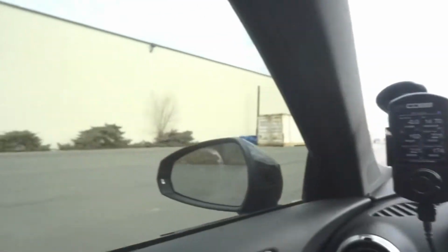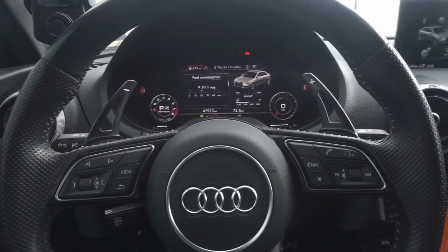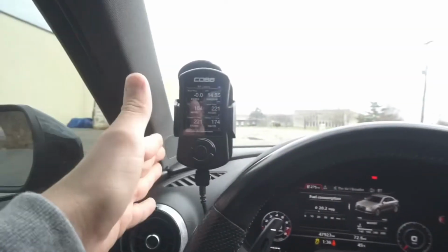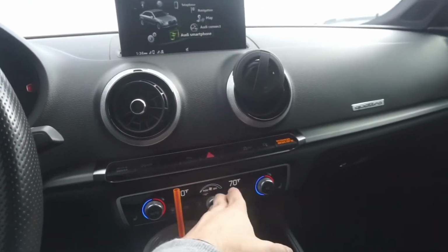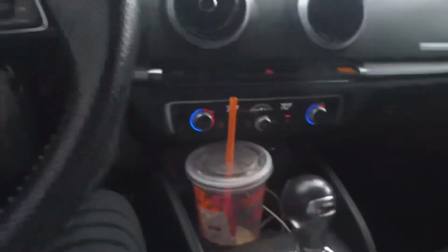You're not trying to go into the building next to you like that. You need the steering wheel to be completely straight, or else launch control will not activate. So, temp, disable your traction control, steering wheel is straight. Next, you need to put the car in gear. So we're gonna put it in drive, as you can see, D.